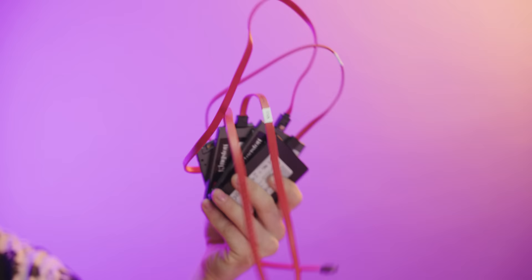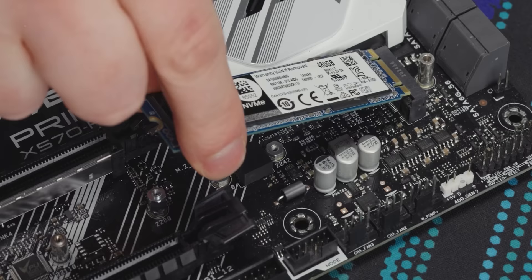This is what's called a USB DOM, or DOM — and it has nothing to do with the much kinkier sub and DOM you may have heard of. Although there are other such terms like master and slave in the tech community, am I right? DOM in this context stands for disc on module, and in many ways it's not that different from any other storage drive. It's just that you don't need any additional power or ribbon cables to connect it. It's just a module with a disc on it that plugs directly into the motherboard, kind of like an M.2 drive, but with much, much worse performance.